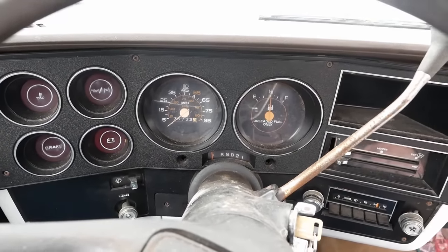I am going to drill and tap these holes for the butterflies. I think the original thread was a 3/48, like a number 3 and 48 threads per inch. I'm going to tap them out to 4-40. I've got tons of 4-40 screws. That'll be better anyway. The other advantage of installing those bushings outside of the original bearing area is that we get away from any wear that's on the shaft. This one isn't too bad, but it does have some.